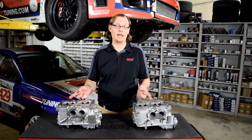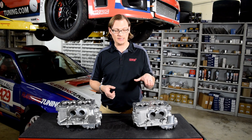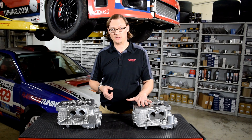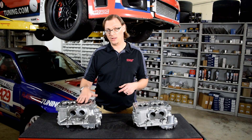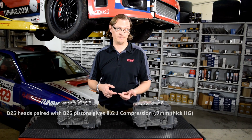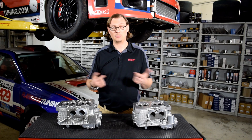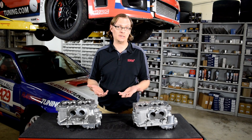So you can start to see why it's important to know what happens if you mismatch. Crunching the numbers: if you took the B25 head — the deeper cylinder head — with the deeper piston from a D25, you end up with a compression ratio of about 8.06 to 1. If you went the other way — the shallower D25 head with the shallow B25 piston — you end up with about 8.6 to 1. So if you put them in the wrong application, your compression ratio can be off significantly from what the ECU is expecting, and you would absolutely need a tune for it.